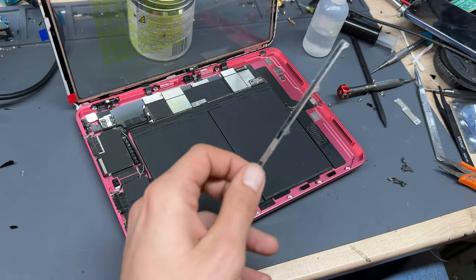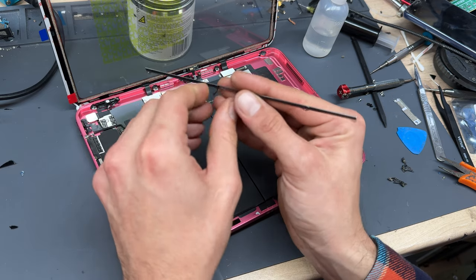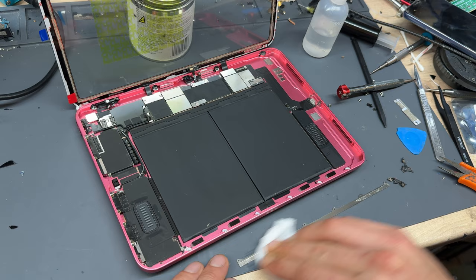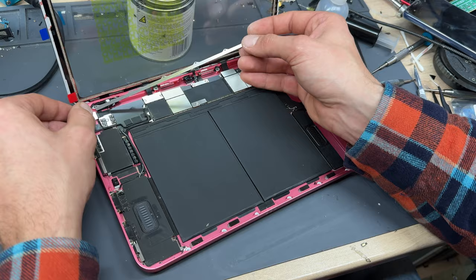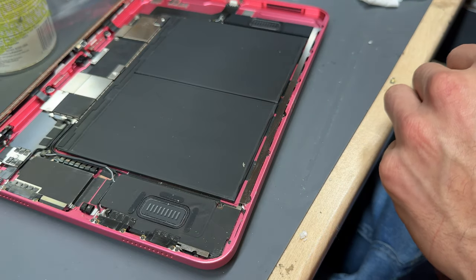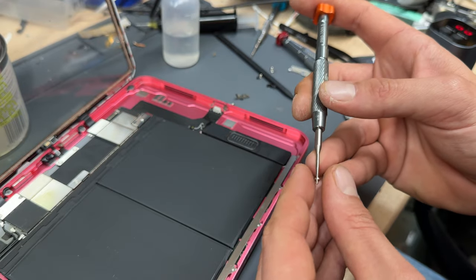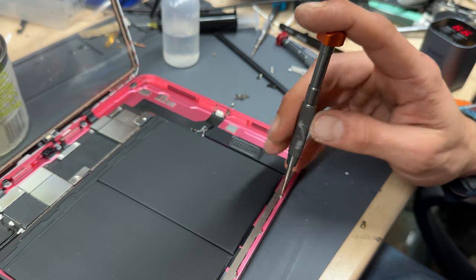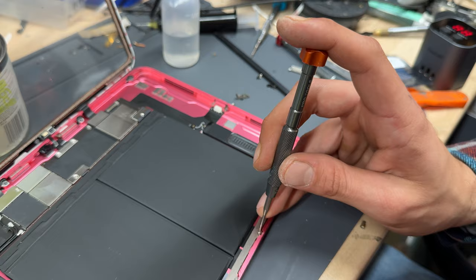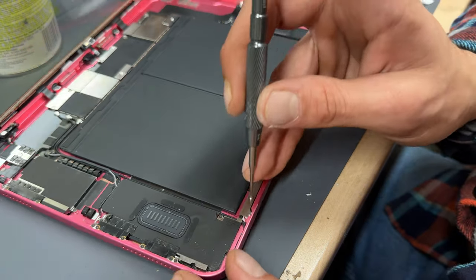I noticed comparing the new LCD side by side that there's not a little bar on this one, so double-check that it has the rail on it. It wasn't too bad to remove with a little isopropyl alcohol and a guitar pick, so I'll let them off. I'm going to clean off the old adhesive. This is the first time I've replaced one of these LCDs, and because it doesn't have the bracket on the back, I'm going to line it up and secure the screws first, then apply tape, to make sure it stays perfectly in line.